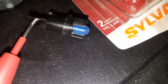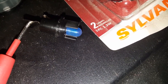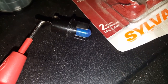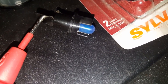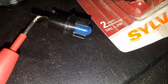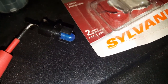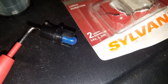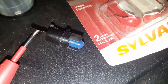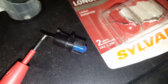The way you want to pull these blue sleeves off the old bulbs is to just roll them off — like a condom. Roll it off the bulb, then stick it on the new bulb: press the tip on and roll it down. If you roll them on and off you won't tear them, but if you try to peel them off you'll tear them. That's the original blue sleeve from the original bulb, and I managed to roll it off and back onto the new bulb.